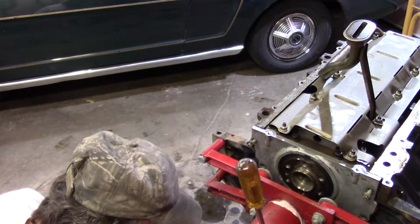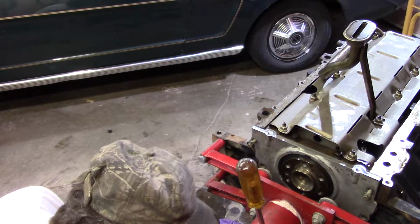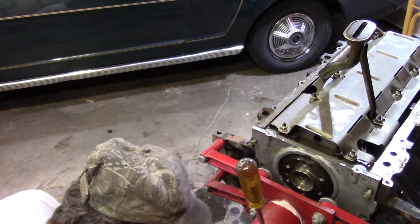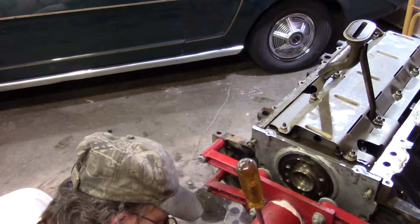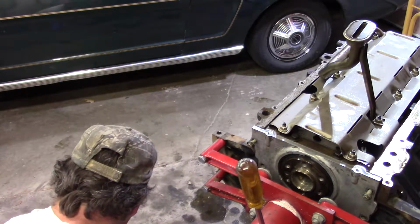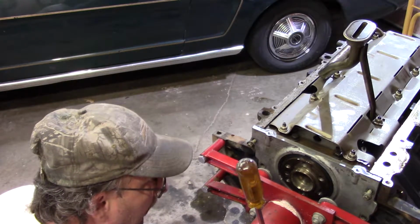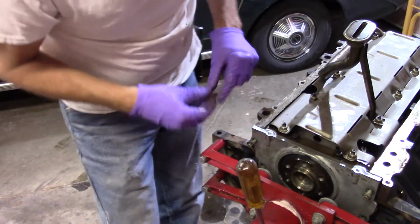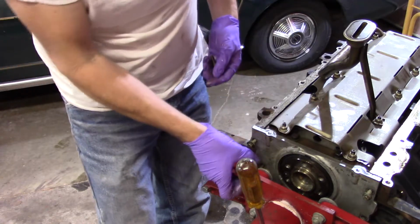And we'll level it up. There's a bunch of bolts at the top, but the reason why is the oil actually circulates through there, kind of goes around in a circle. I really didn't show you the back of the block or the crank or this plate. But if you ever do one of these, you'll see when you pull that plate off, it actually has some oil galleys behind it, and it's sealed up kind of separate. Not very easy to get to.